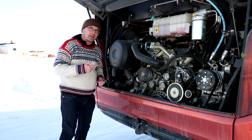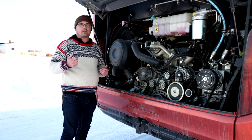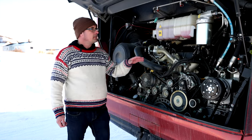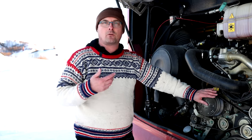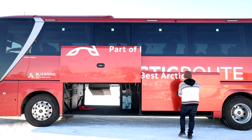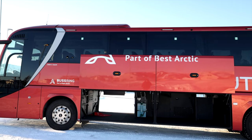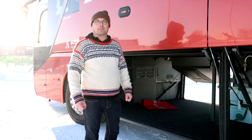Maybe they should also move the diesel tank to another place. This is the heart of the bus — the D26 engine with 510 horsepower, a lot of torque, and connected to the Tipmatic gearbox, a 12-speed automatic-manual gearbox. You have easy access to every service point you need. It's easy to change the belt, check the oil levels, the cooling systems, the air filter. The water pump on the D26 has a clutch, meaning when you need cooling circulation it starts, and when you don't need it — to preheat the engine — you disconnect it, so the engine can reach the right temperature as soon as possible. You also have a separate water tank that you can remove, fill up, and bring back — you don't have to drive the whole coach to where you can fill water. It's so freezing cold here, so let's go inside again.